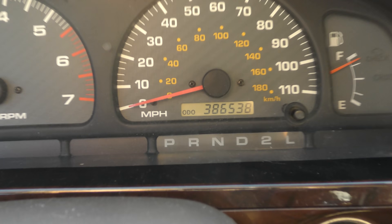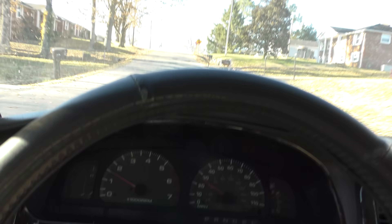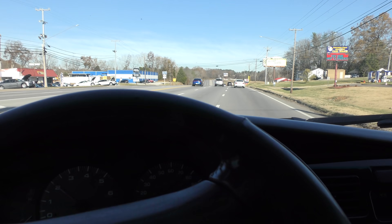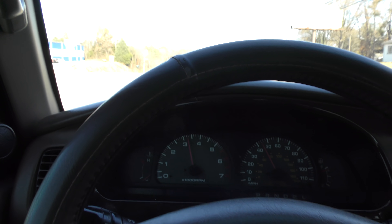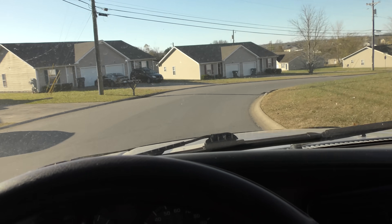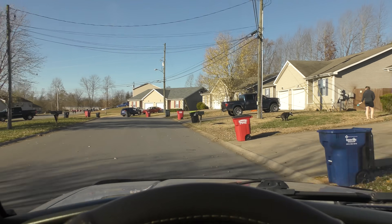We'll take this 4Runner as an example — you can see it has 386,000 miles, so you'd certainly expect the shocks and struts to be worn out. Let's take it for a road test. When we hit dips, it does have a little bit of a bouncy feel in the front. Out on the highway it's not particularly shaking. I don't feel any real loss of control and I certainly don't feel the back end swaying around. If you're driving at highway speeds and hit a bump and it starts shaking, that's a pretty good sign they're worn out — but this doesn't even do that. It's just a little bouncy in the front, and it really doesn't corner all that bad, especially for a vehicle with 386,000 miles on it. So they're not outrageously worn.